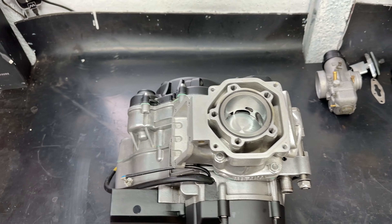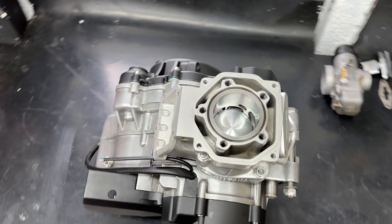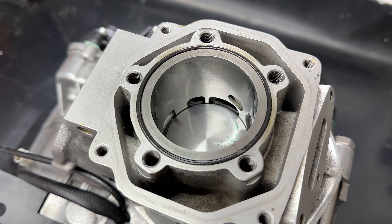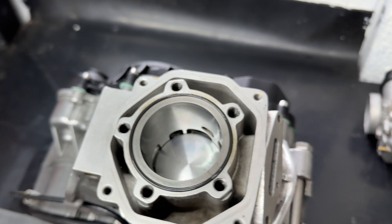Initial impressions look really good — I can see a brand new crown on the piston in there, no carbon build-up, so it's pretty obvious that's a spanking new one. Using a pair of mole grips on the old sprocket just to rotate the engine, I then ran the piston down and can confirm we do have a good bore as well.